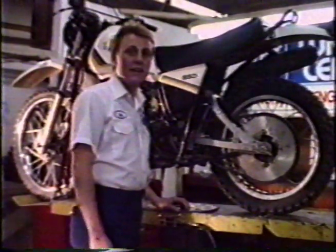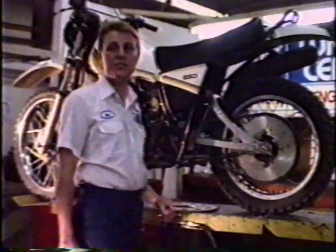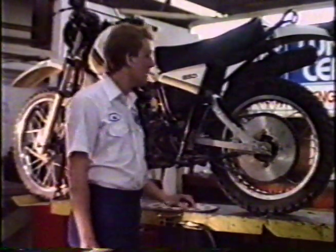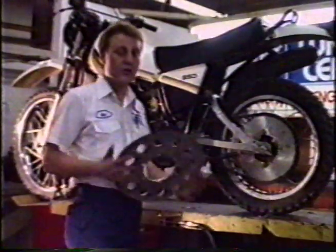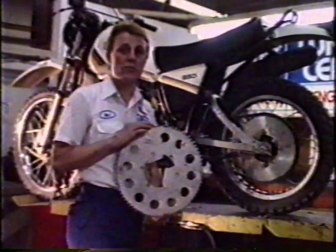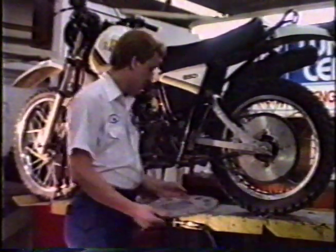For off-road riding, gear as low as you possibly can. I'm running an 11:62 ratio that I got from Azusa Engineering here in Covina, California. That's the lowest gearing that I could run without modifying my swing arm. If that's not low enough for you, Sprocket Specialist has sprockets available up to 74 teeth. I use this one on my '83 KX250s.